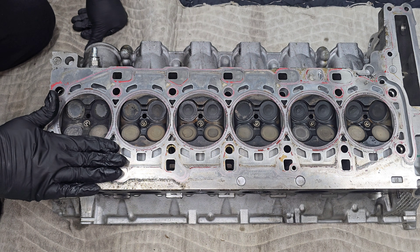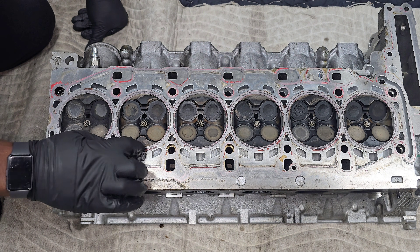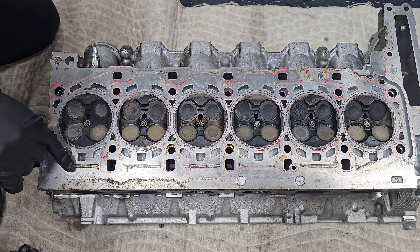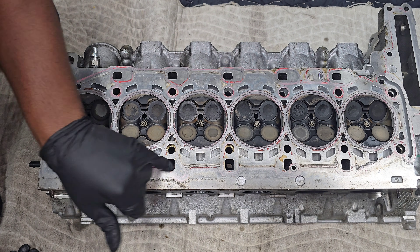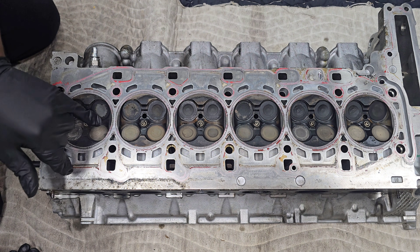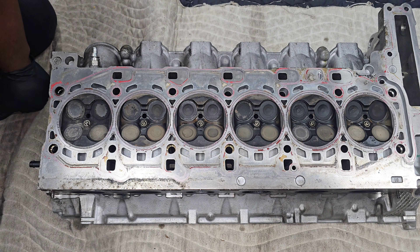This surface needs to be completely flat to get a good seal, and then you've got a gasket between the surfaces — that's where you see these red witness marks and leftover residue from the head gasket sealing to the cylinder head. If you do have head gasket issues you could get compression loss between cylinders, oil going into your coolant, coolant going into your oil, or coolant going into the cylinder and getting burned. These bigger ports are oil flow ports. A lot of different things could potentially be happening, but nothing immediately jumps out at me.